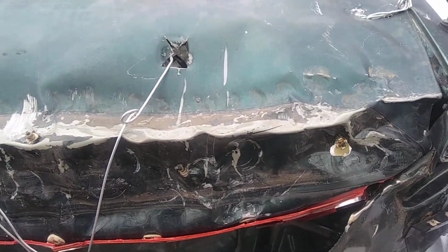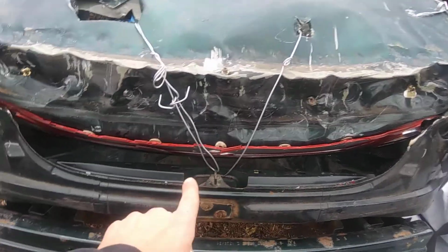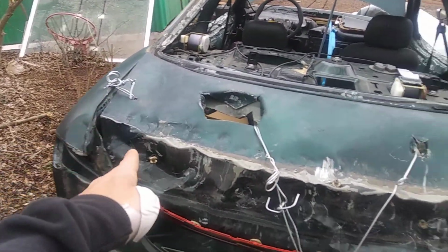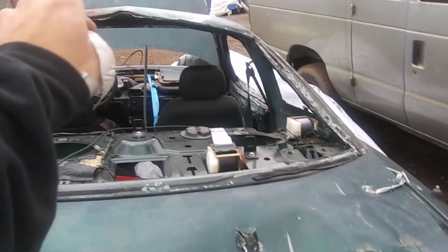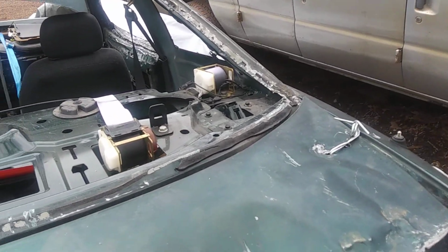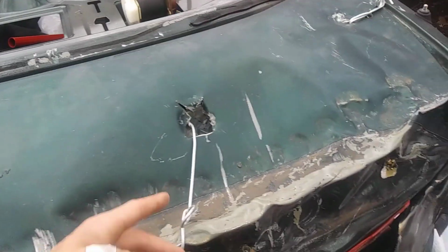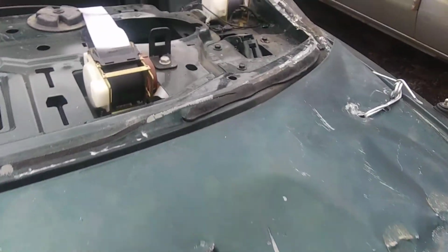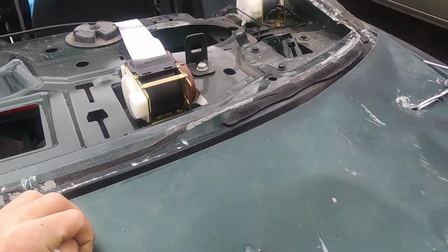I'm not going to run all the way down to the scrap pile to show you what they actually look like. But I highly suggest taking them out, because if this wire should break and pop out from behind the seams we got tucked behind, the springs would hold this up, and we absolutely would not be able to see out the back. So a quick tap with a hammer will ensure your trunk's not going to go up, unless somebody hits it and it goes up anyway. But at least it has a chance of falling back down, and you get the point.